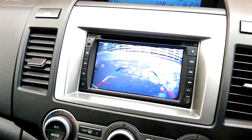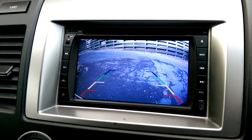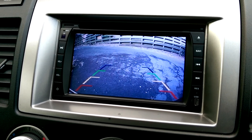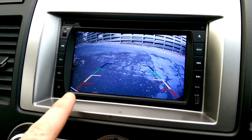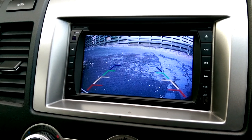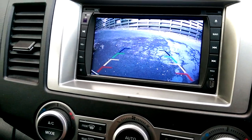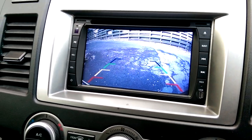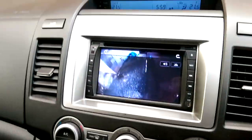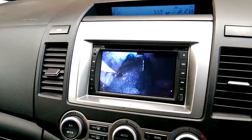If I put the car into reverse, it will switch to the reverse camera — the old stock one was left behind and this new one was added in, so it just sits next to it and is angled in a way I like. That covers pretty much the edges of the car with a wide angle lens. I tested it by putting things on the floor point blank right below the car and you can see them through the fisheye lens. Once I go back into drive it'll just go back into whichever camera it was before, so I can go backwards and forwards between the two.